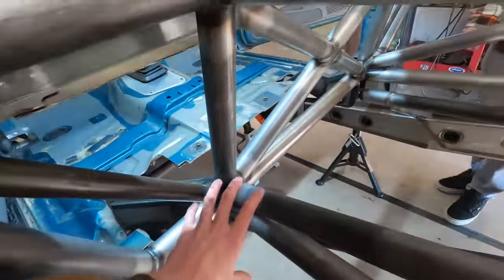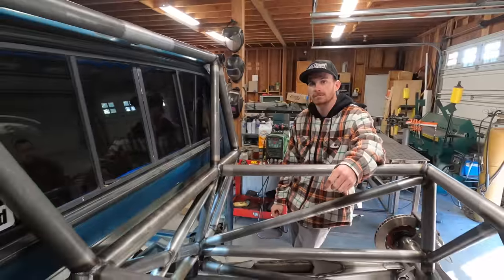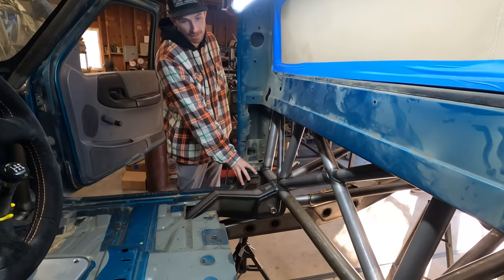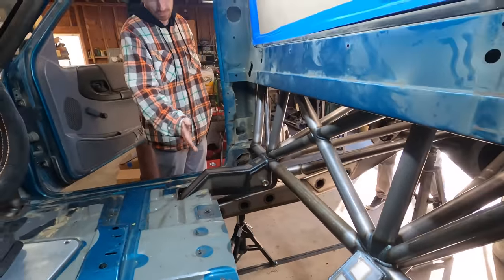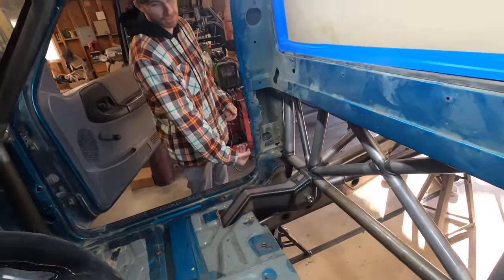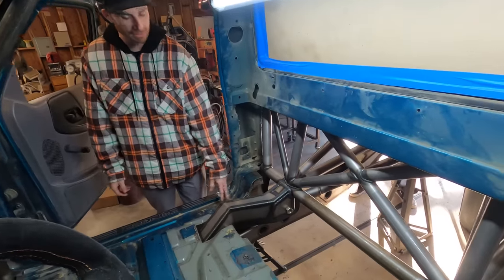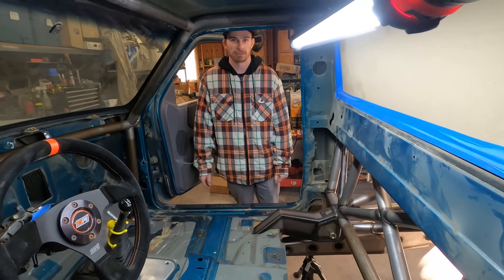I started with the belt line tube basically first — just ran it across the truck and held it up with pipe stands before I had the back wall cut out. Then ran these tubes down to it, ran the tube across, ran these tubes down, got all this structure in, and at that point it could hold itself. I pulled the pipe stands out, cut the back wall out. When we cut the frame off, the body mount got cut out of the truck too, so the only thing holding the back of this cab up is the pipe stands and this structure. Once the cage was in, I could cut that section out — the tube will run down and the floor will be rebuilt back into all the tube work.